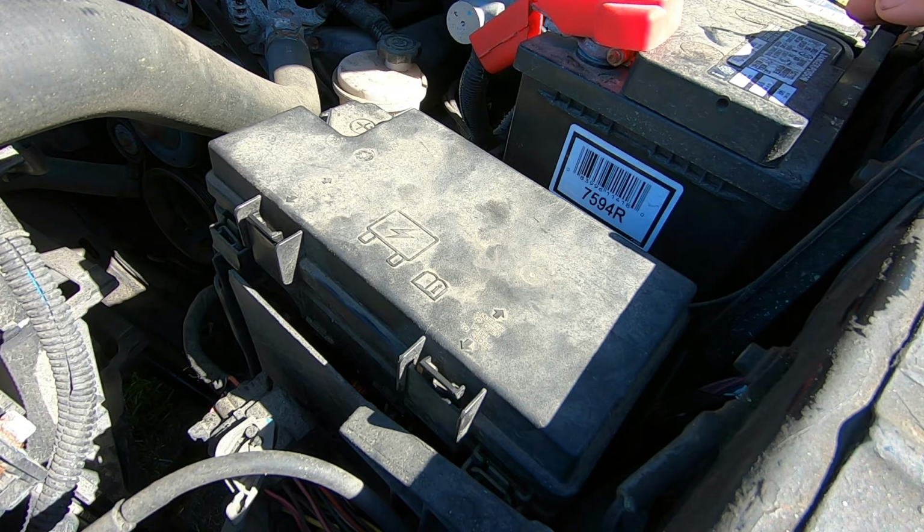You have to turn off the key to stop the fuel. So here's the inherent danger in doing what I just did. You do this at your own risk. I can see using this to get yourself off the road, or for a very short term to get the car to a repair shop. To just use the car this way indefinitely, I don't think it's a good idea. You're putting yourself and first responders in danger should there be an accident. The other thing is, if you put your key on just to listen to your radio, your fuel pump's going to be running and you could run your battery down pretty quickly.